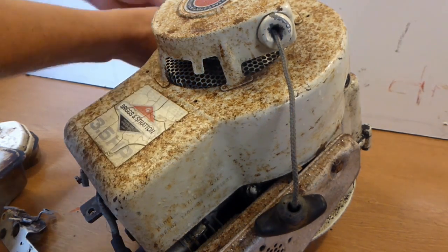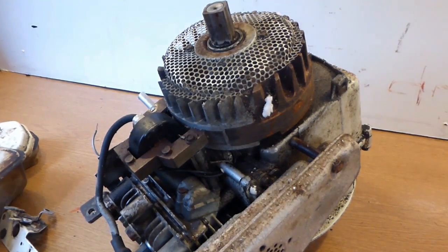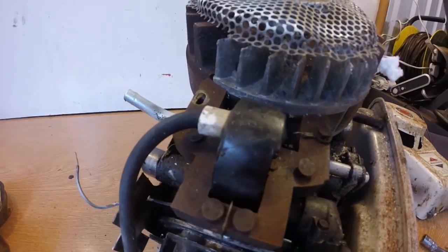What I'm going to do is remove the top cover of the engine and check everything inside, and obviously rebuild everything which is missing. When I lift the top off you'll see that everything which should be there is there — the coil and everything — and it's just the one thing which is missing, and that is the governor flap which just goes on top of the coil. You'll see there's a bolt missing and that's where it bolts on.